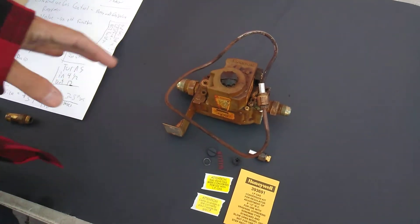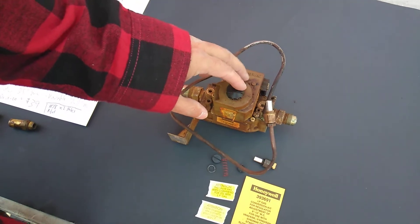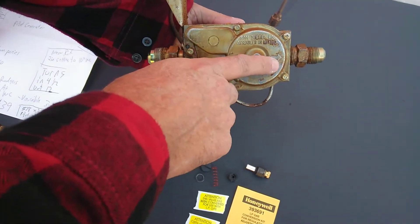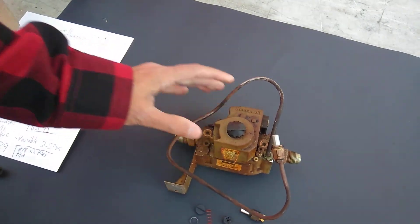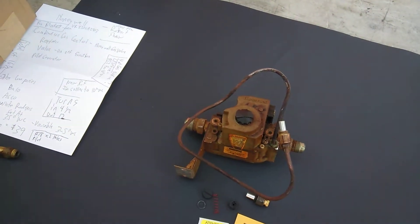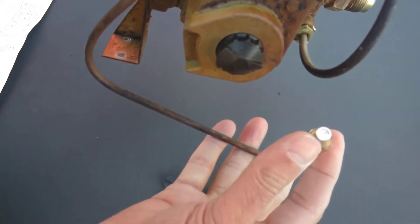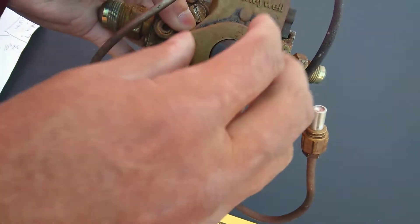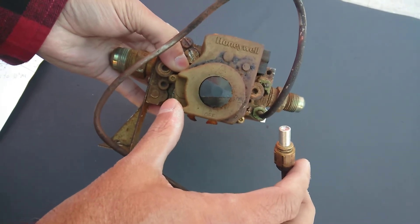To do the conversion — first of all, this is called a control, not a regulator. Even though the regulator is part of the function of what this is, as you can see there's a diaphragm in there. This shows the flow of direction — the gas is going to flow from here in, so that's the inlet, that's the outlet. But it's actually a multiple-function device. It is a regulator, but it's also a pilot generator. This is a pilot orifice here. You can see the little holes here — the gas comes out of there and gives you a nice little pilot flame. Also, it will not allow you to turn on the oven without there being some type of flame source in the oven present.